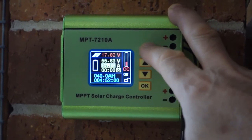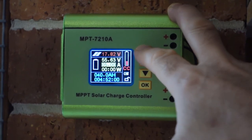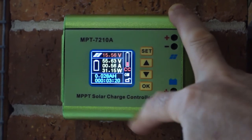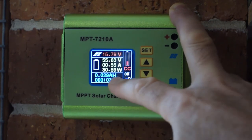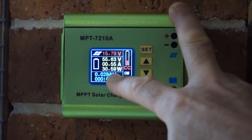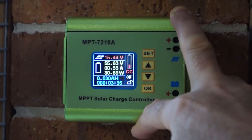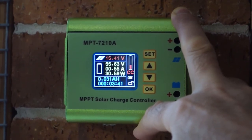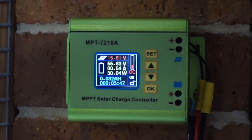The current is set to a maximum of 5 amps, though it should never reach that. This controller should also transition from constant current into constant voltage mode once it gets close to the set voltage, so the current tapers down and the wattage tapers down in line with that. So that's how I charge my bike using solar — free electricity from the sun. See you next time, bye.